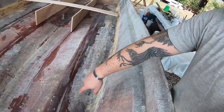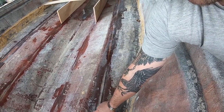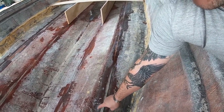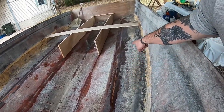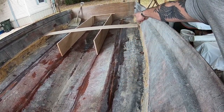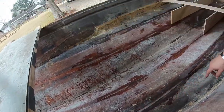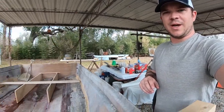and what I did was I had some low spots, so I filled it in with some thickened reinforced resin, some half-inch chop strand fibers, and then whatever wood was left, which wasn't much, and it was good wood, I just resealed it with some epoxy resin and then came back and filled in the low spots. So today we are measuring and test fitting some stringers. Kind of in a dilemma here at the moment, and I can show you what I did.